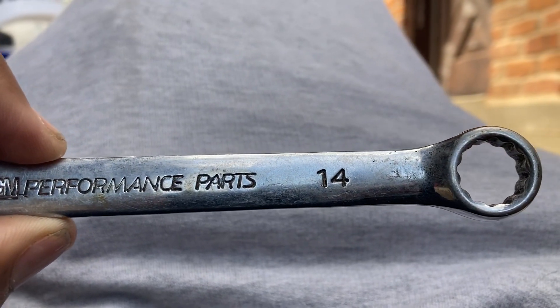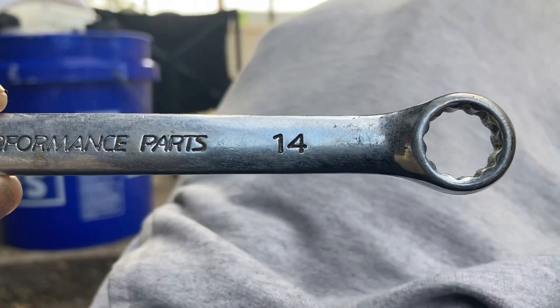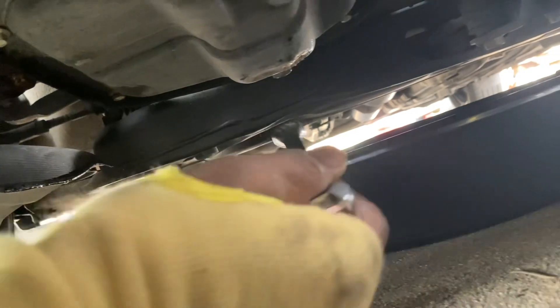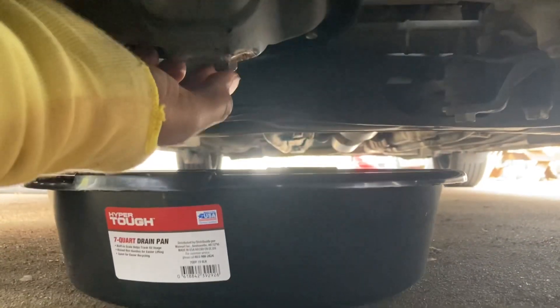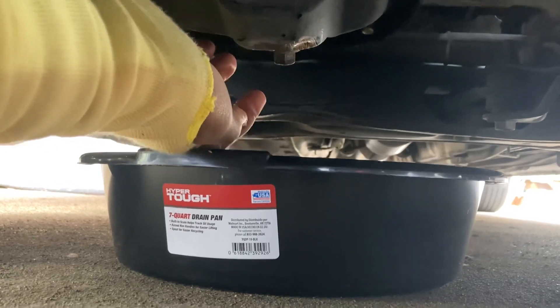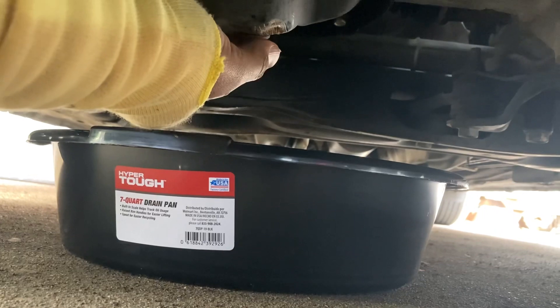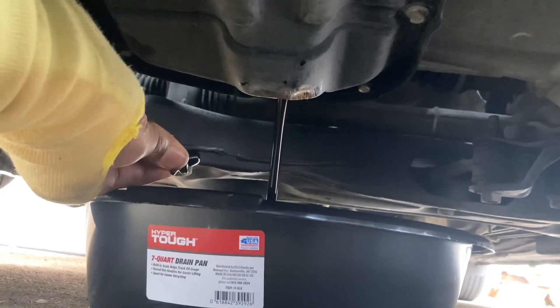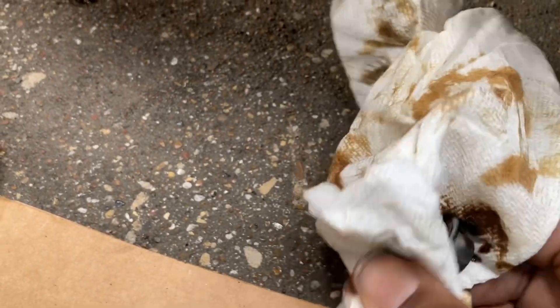So what you're going to need now is a 14mm for the drain plug. See how it hits right there — out of all places on the car, that's what they hit. So you're going to put your wrench right there on that bolt and then turn it towards the passenger side. Loosen it by hand — I usually have a surgical glove on. As you loosen it, when you get pretty much where you want to be, you want to push up on it while you loosen it. You'll notice the threads are no longer in your way. Then keep loosening it and snatch it out. Otherwise you're going to have oil all over the place. Push in while you loosen it, and then just snatch the plug out.